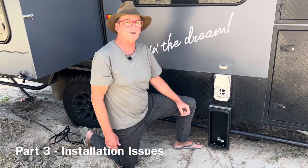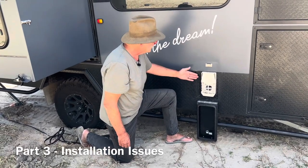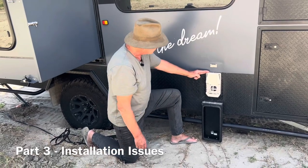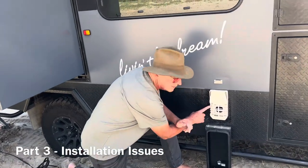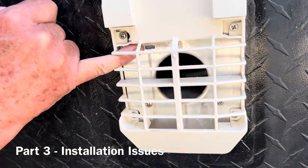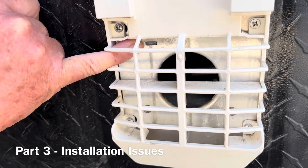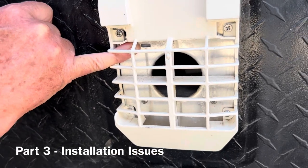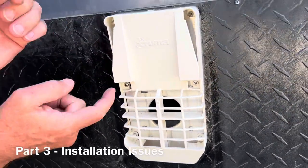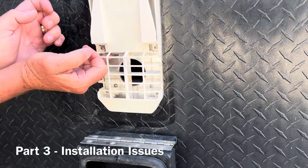If you've got trouble lighting your gas, this installation gap is going to cause that. There's a quick way to check: under here where my finger is there's a little tag that comes through a hole. On ours it looks quite black because the tag did not come all the way through. There's a tag on the manifold, and when this flashing plate is screwed to the manifold, that little tag should be flush with the front. If it's not, you've got the problem shown in the photos.